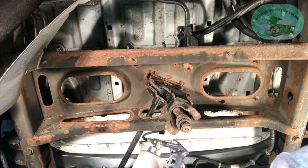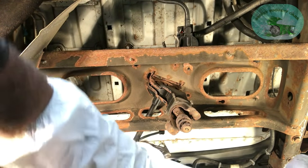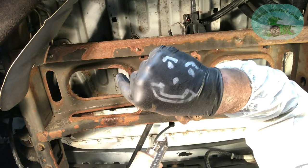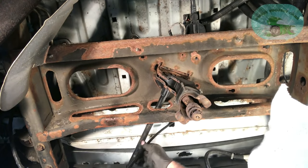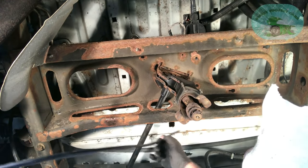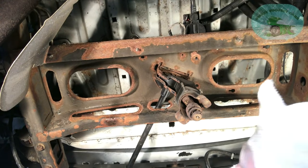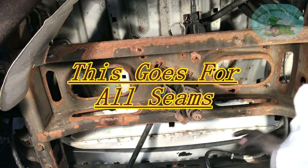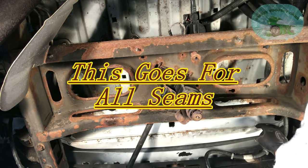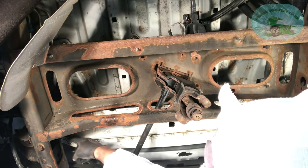You've got to stick with me because I'm sure I'm going to go out of camera a little bit — there's so much area up here. Now when I was talking to you about seams, this is what I'm talking about — that seam right there. Very important: when you get your other sprayer nozzle on, hold it right tight against that seam and really inject it in as best you can.